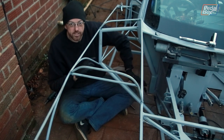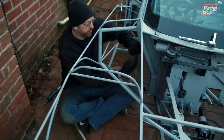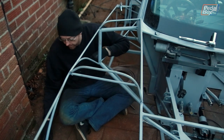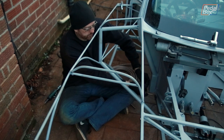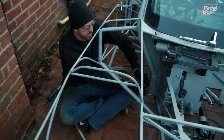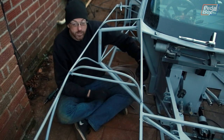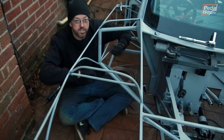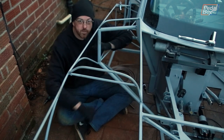The next thing we need to do is get through what will be the panel here to form the forward part of our bulkhead up to the edge of the car. We don't have that right now but we do have our bulkhead connectors, which go onto the end of these hard line fittings. We're going to have to put this one and the one above it for the return line in exactly the same plane, and when we come back we can disconnect the lines, slide them through, and fit them all up nicely.